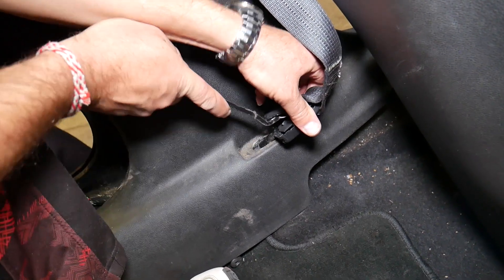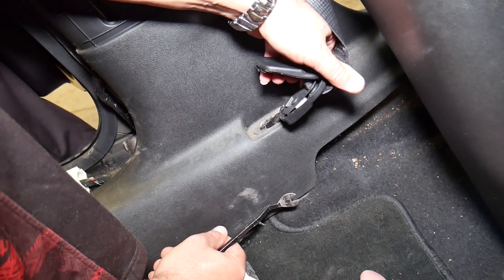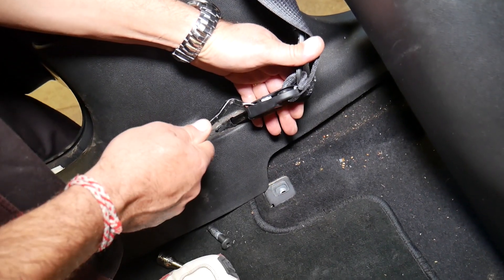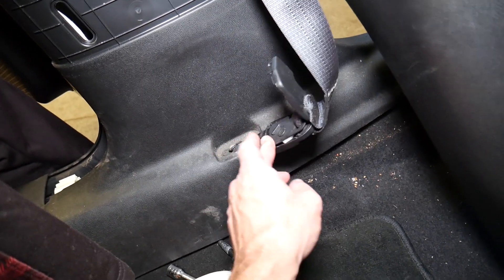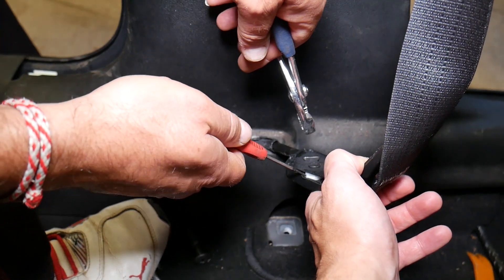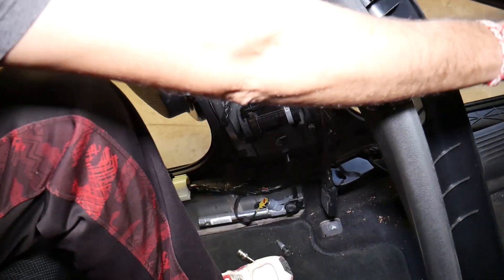The little cap needs to go up. We'll get a slightly bigger tool. Just a few clips holding it in place. Check it out — this is a complicated mechanism; the two pieces will fall apart. We need to open this mechanism and inspect everything to make sure it's correct for your vehicle, because if it malfunctions or isn't installed correctly your seat belt may come loose later. There's a white mechanism inside that you need to push counterclockwise while grabbing it with pliers. Turn it and it comes out — the seat belt and the pretensioner are now separated.